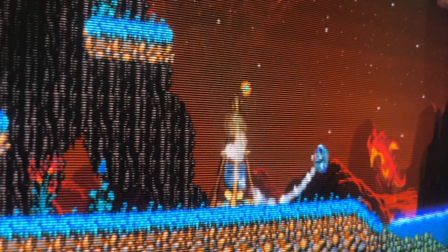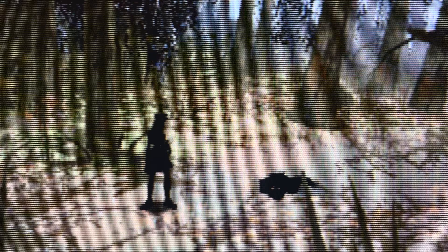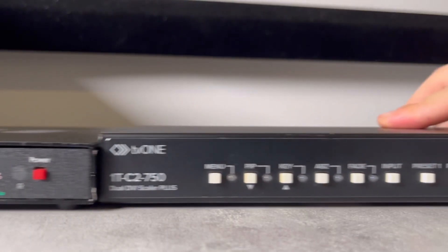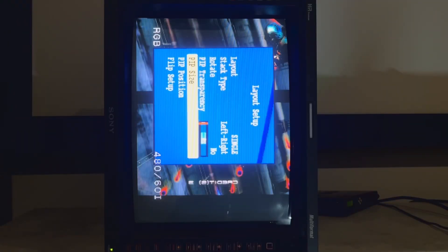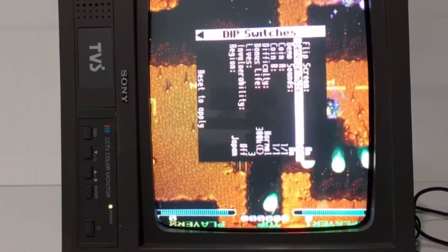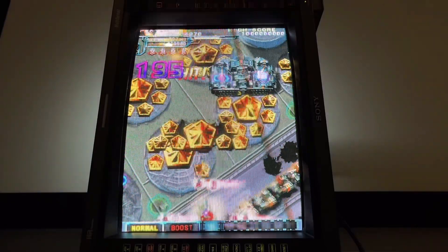So what to make of the Daito Jr. as a 240p downscaler? While it could be classified as a GBS control on steroids given that it only outputs 240p but accepts 720 and 1080p, I'm more inclined to call the Daito Jr. a crippled Choreo 2 scaler. They both share the same input resolutions, but it misses the mark by not having a 480i output and no downscaling under 2 frames. It's not a bad downscaler by any means, just not one I'd recommend given they're generally more expensive and harder to find than other options. The Daito Jr.'s trump card is that rotation feature, so in the very rare chance that your retro gaming setup can stomach 3 frames of lag and you have no other means to rotate the video by software, then this is the downscaler for you.